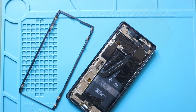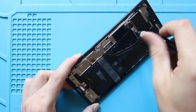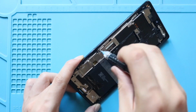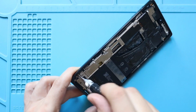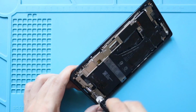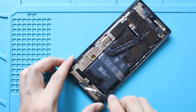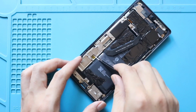Next, take out the cover by undoing 5 screws and take out the charger port bracket by undoing 2 screws. Also, gently pry the graphite tapes from the battery, which are attached to the cover. Next, take out the cover using a pry tool.